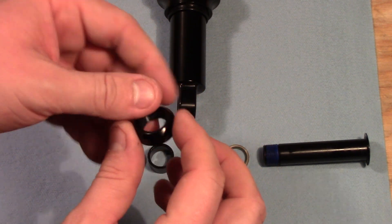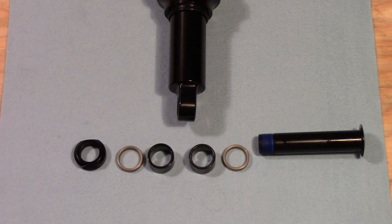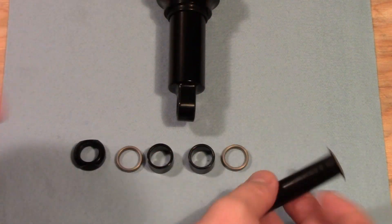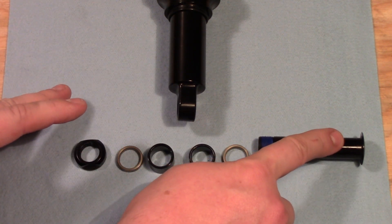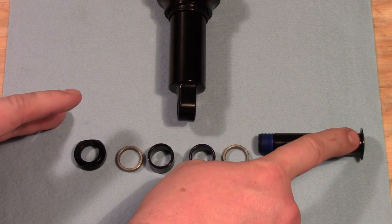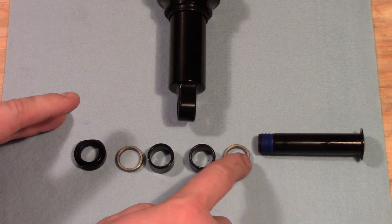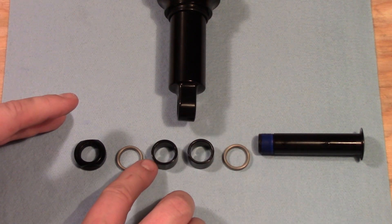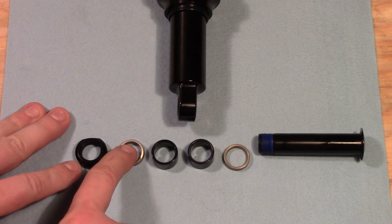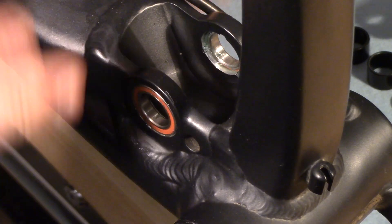Additionally, this end cap here matches the diameter of the bolt head. There is another nut that looks very similar — this one has the torque spec on it and is much much larger; it's going to go with a different set. The order that this is all going to go together: we put the bolt in first, then this end of the bolt goes directly up against the bearing on the lower rocker arm, then we put the spacer between the bearing on the lower rocker arm and the bearing in the frame, then we put these two spacers around the lower eyelet of the rear shock, and then this spacer again between the frame and the rocker arm. This is going to go on the drive side, which means we're going to start inserting from the non-drive side.